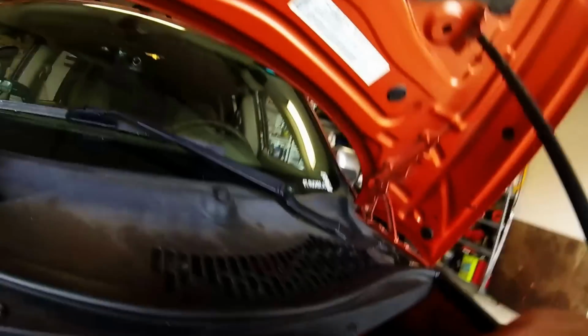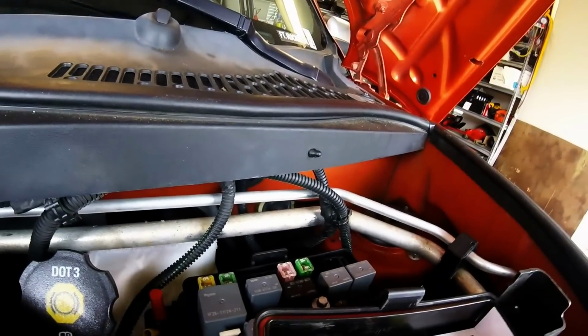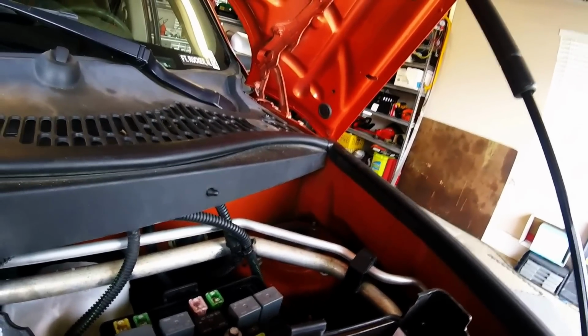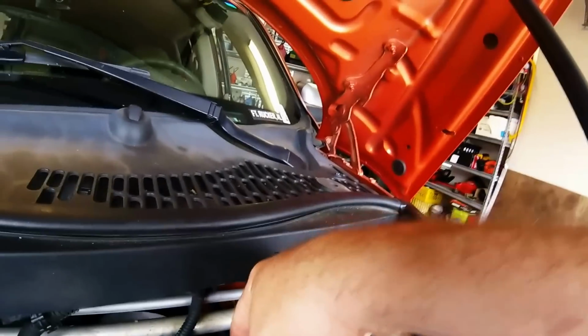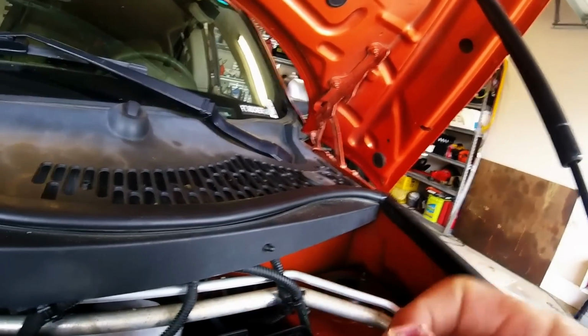So I go through every fuse in the car, everything that says HVAC, fan, anything that looks like it, and nothing. So here's a little trick, a tip to save you some time, because this took me a little bit to find out and research. Right here in your fuse panel, if you look at fuse number 4, BCM number 3. Now that's body control module. I can't figure how this works, but anyways, BCM 3 number 4, which is right here, this empty spot, is one of these fuses right here.